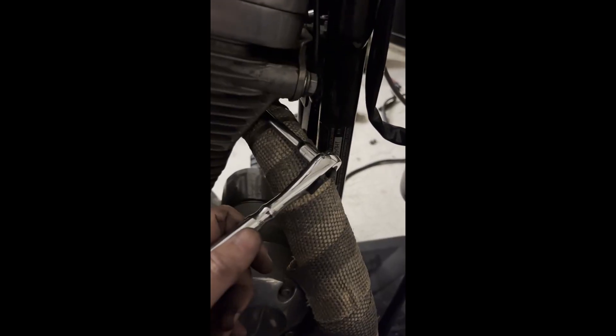Two half-inch bolts — the back one first because it's easier, then the one on the bottom. Under here is another half-inch bolt securing it to the back side for the rear exhaust. It kind of follows the exhaust flange on the top side. On the bottom side it's easier to get it from the other side of the bike. Once it's loose, use your fingers to get it off. The exhaust is off — it just had to slide forward, swing it forward and slide it to the front of the bike, and it slides off that little slider.